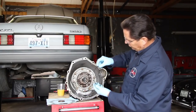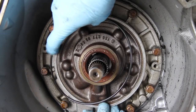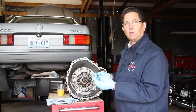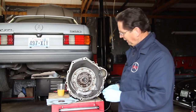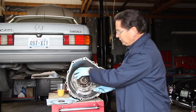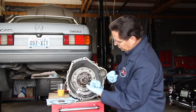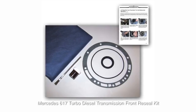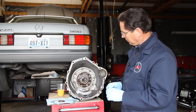What seals this front cover is a large O-ring that you see here — you can see where it sits right on the edge of the pump housing. The problem with this O-ring is it ages and hardens, eventually getting so hard it no longer seals, and transmission fluid can leak right by it. To replace this seal, it's a little complicated. You can't just pull this off and put a new O-ring on. You have to take all these bolts out, pull the whole front section of the transmission out, then get in behind and remove the bolts from the inside. I currently have kits available for the older transmissions — most diesels from 1984 and older — and hopefully I will have one for this transmission once I complete this repair.